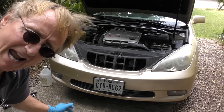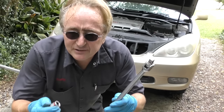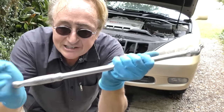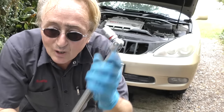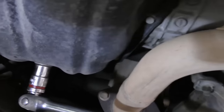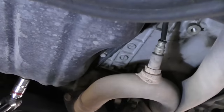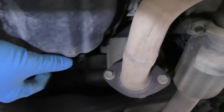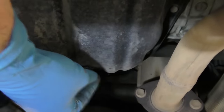If you're going to change your own oil, get a good jack and jack stand. A lot of people think they're not strong enough to get the bolt off to drain it. You get a long extension bar like this — the socket goes right on it — and with all that leverage anybody can pull it off. Once you line it up you got to pull hard, but it gets loose pretty fast. Then it's just a simple job of using your fingers to spin the thing off. They've got pretty long thread, and out comes the dirty oil into the pan.